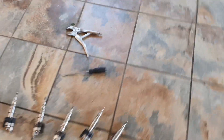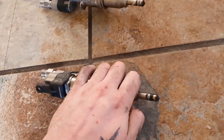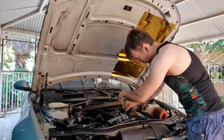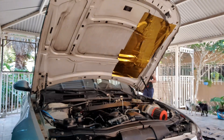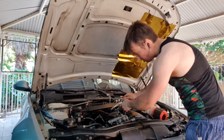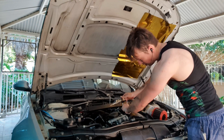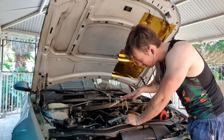I got all six injectors out and all of them look really really dirty. In fact this one has pieces of carbon on it - that one is dirty as hell. So all of them don't look too great. What we're going to do now is put them in the wrong way - upside down - so you'll literally be able to see where they're leaking or not. When you crank the car it will get pressure in this little pipe here, and if it leaks it's going to leak out there. If the injector is fine it will be dry at the tip; if there's a problem it will leak.